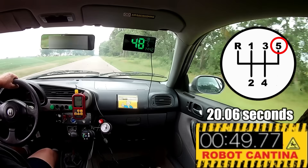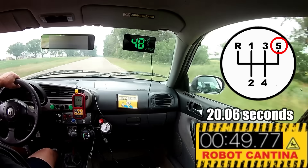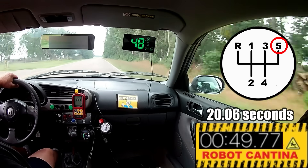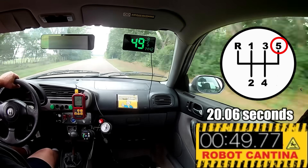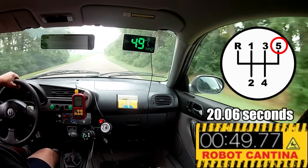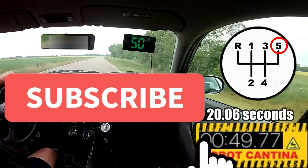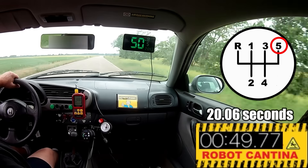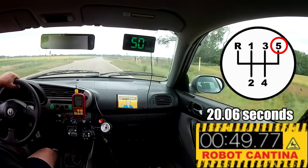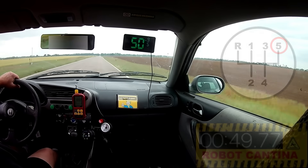What that means is I can floor the accelerator and twist the knob back and forth for more or less power, and the engine responds accordingly. The fuel rack limiter does indeed work to some degree, and I think now we need to focus on adding additional sensors to the engine so a microprocessor will have enough data to automatically set the boost and the fuel trim, so our old school diesel engine can appear to be a normal engine when we attempt to drive this car in a big city. It was a short week due to the power outage and the troubles with the fuel rack gizmo, but I'll see you next time.